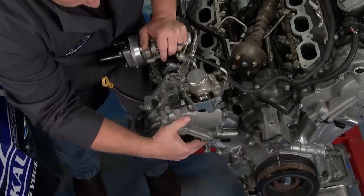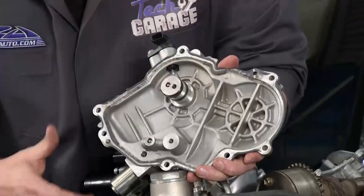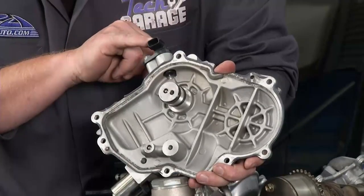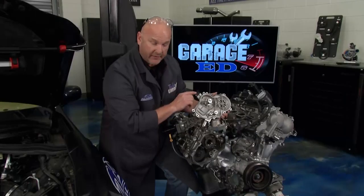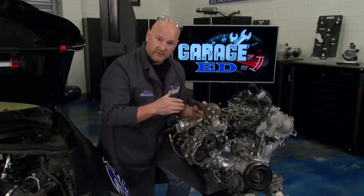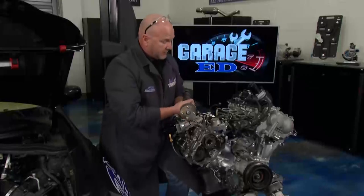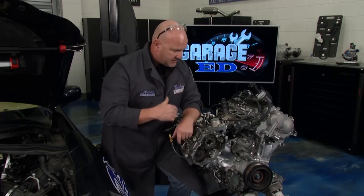Variable valve timing is some of my favorite vehicle technology. If we pull this cover off — I've got all the bolts out — here's what's going on: oil pressure comes in behind the cover and shoots in here to adjust or phase the camshaft. The camshaft position sensor watches these teeth, which are located right on the end of the camshaft, and it knows where they are in space. When we adjust the camshaft, we're trying to keep exhaust gases in the combustion chamber longer by keeping the exhaust valve closed longer — advancing or retarding timing. All done with oil pressure, and it puts a little more pressure on us to keep the right oil clean in our engines.